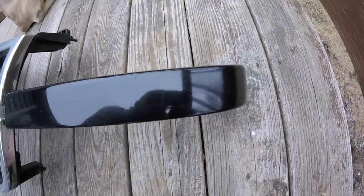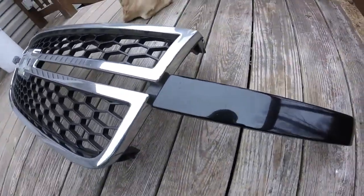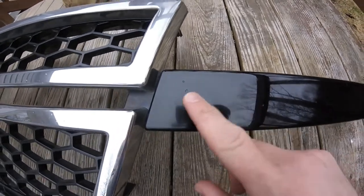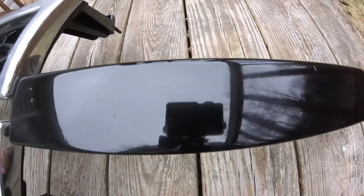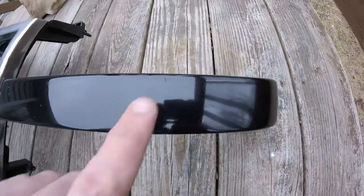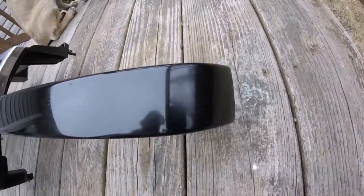Now, it's taken about 5 or 6 times wet sanding it with 2000 grit. And there's still some areas that aren't perfect. Like right in here, it's a little dark and hazy, but over here, it's like a gloss mirror. At least that's what I see in person. And, you know, there's still some stone chips because I opted out of using filler primer, so shame on me.